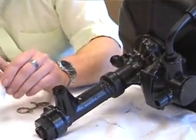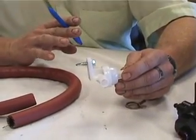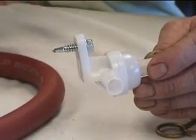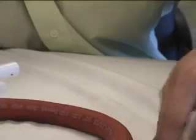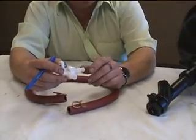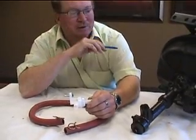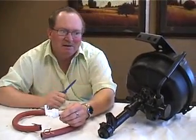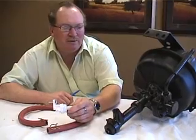Within the kit there comes a little check valve. You might have a check valve already built into your system on your truck. If so, make sure that it's working — verify that it holds vacuum and is working properly. If not, throw it away and bolt the new one to the firewall. There's a piece of hose and two hose clamps that come with it. That check valve protects against gas fumes that can develop over time, which will erode all the rubber in the Hydrovac. It also ensures vacuum doesn't leak away, so it's simply a protection to make sure your Hydrovac works properly.